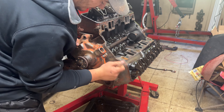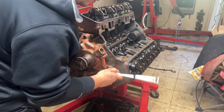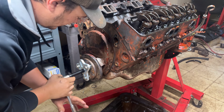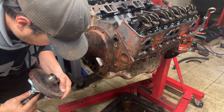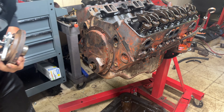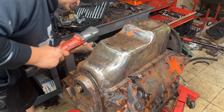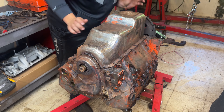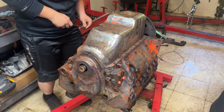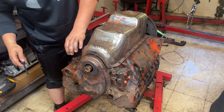I'm not a hundred percent sure if we're going to reuse this water pump - it'd just be better to go get a new one so we know we're good. We got our puller set up. Let's see if we can get the harmonic balancer off. There she is - right off the edge of the crank. It's a press-in so it doesn't have a bolt that goes through the center of the crank. That was a special 283 thing. She was a little stuck but got some help and came right off.